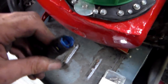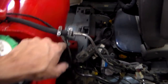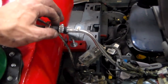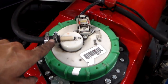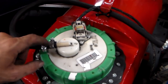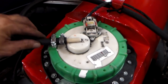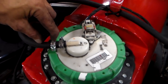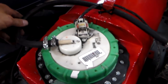Where this clips in, you'll see once you clip these that there's a notch on the rail — you can actually see it right there. The 3/8ths slides right over nice and snug. But it will not fit over this, so you will have to shave that little nub, that little ring — shave it off to make it nice and smooth. Then it slides all the way over. The end is like right here, the notch is right here, so you only have that much room. Shave that notch off, slide it all the way on, double clamp it — it's good and tight and safe.